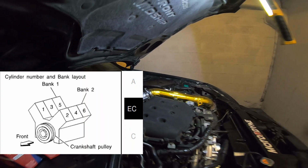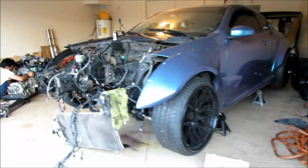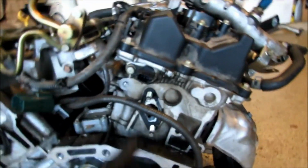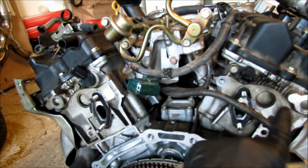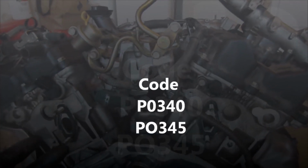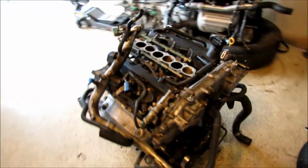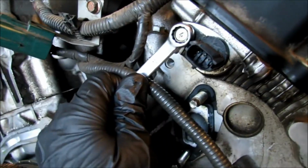You don't need to remove the air intake. But for bank 2, to get easier access, you're gonna wanna remove the air intake. So if you're looking for where they're at, they're on the very back of this engine. Right here, and right here. So when you get the cam sensor code, which I forget what it is, I'll put down in the description, this is where you have to go to replace it. So here's the front of the motor, just like this. On the very back side, you're gonna reach behind, just a 10mm. Crack it to the left.